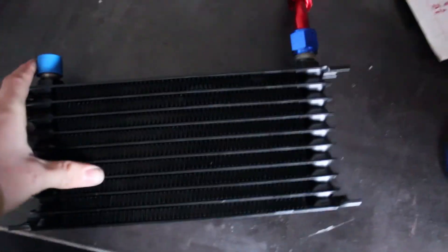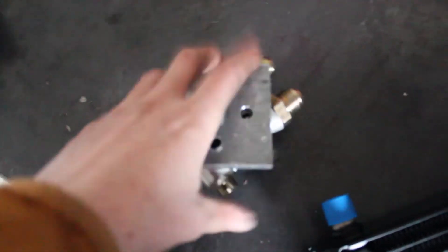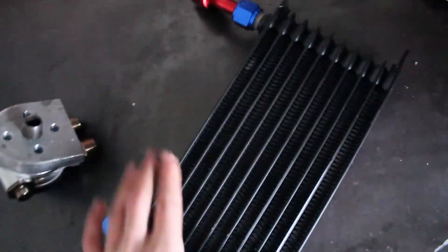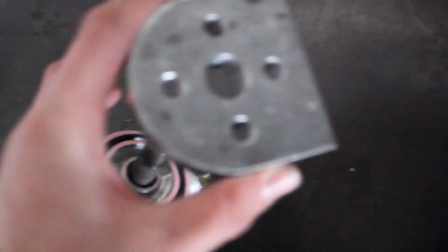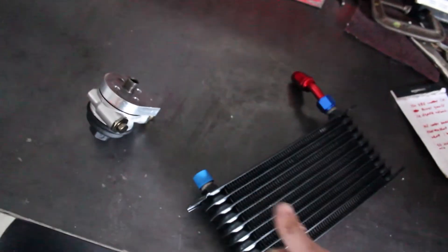And I can have hoses coming off of here. I also got a cheapo eBay $30 oil cooler — I'll link this down in the description too. This is just a 10AN oil cooler, G Plus or whatever brand — it'll be good enough for me. These lines will just run to those, it doesn't matter which direction, it's really easy to set up. I'll put this somewhere like around my intercooler. So this ultimately cost me $60 in total — $30 for the sandwich plate, $30 for the oil cooler, the aluminum spacer I had laying around and just drilled holes in it and cut it. Pretty simple, cheap, DIY external oil cooler.